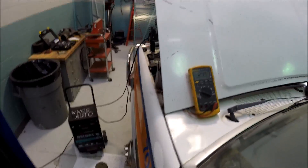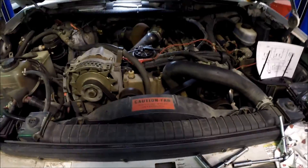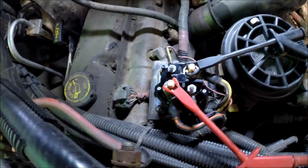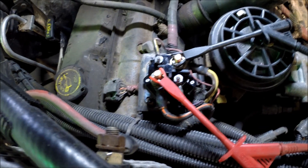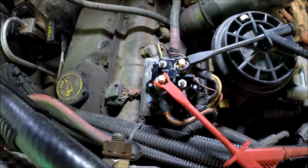This is one way to examine the glow plug relay on the Power Stroke. This is such a common failure, and lots of people will do it lots of different ways, but this is pretty easy to do. And it doesn't just tell you that the relay is bad — it gives you an idea of how bad and exactly what's going on. That's why we like the voltage drop test.